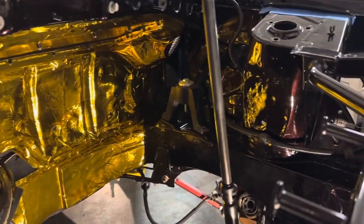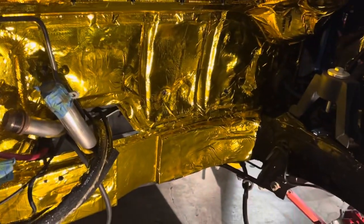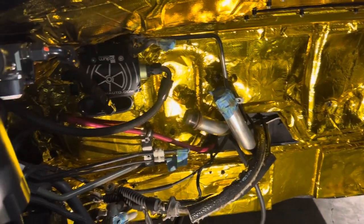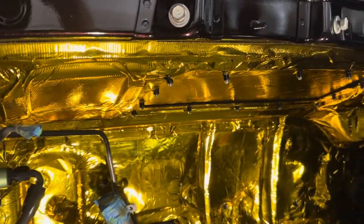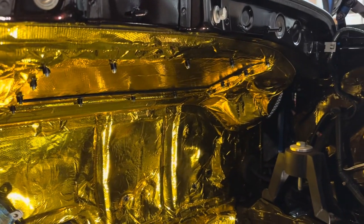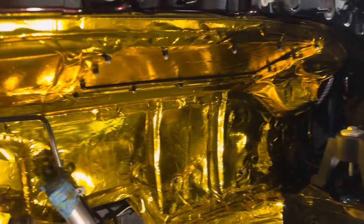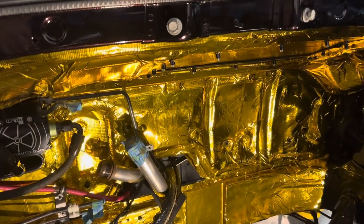What we do see here that's quite different from last time, as you can see, we have a ton of DEI reflective gold in the engine bay. The reason for this is the front side of that engine does have a turbo manifold on it that gets quite warm. The turbo manifold does have quite a bit of heat shielding on it — technically it has a Polydyne ceramic coating as the first layer, then Inferno wrap from Heat Shield Products, and then on top of the Inferno wrap is header armor. So it takes that manifold temp down from around 1100-1200 degrees down to about 300 on the surface. This reflective heat barrier will help keep that heat from going into the firewall and into the cabin.